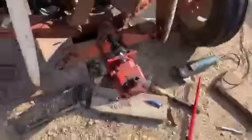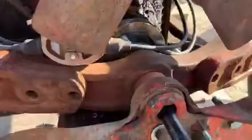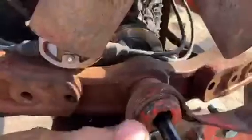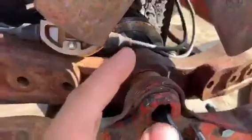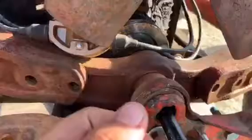I ended up having to take a loader off of a later Ford tractor. This is a 2N by the way. I had to buy a new front crank pulley that has four tapped holes. There'll be a link in the description — there should be a splined hub that bolts up to that special pulley. Don't buy the cheapest pulley though. I bought the cheapest one for about 33 bucks and I had to re-tap the holes because they weren't working right — not a good idea.